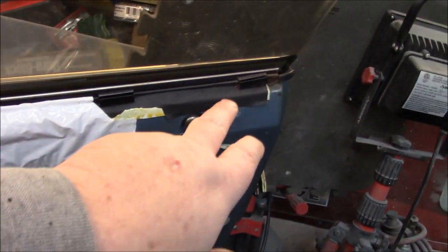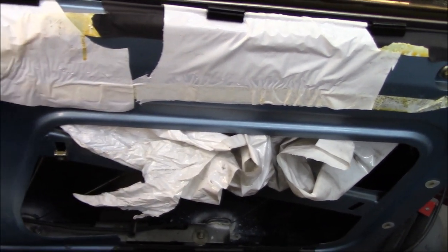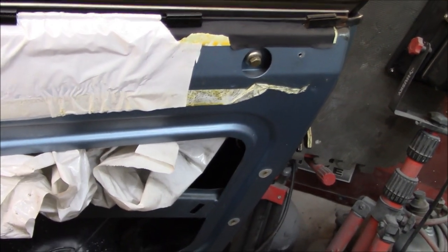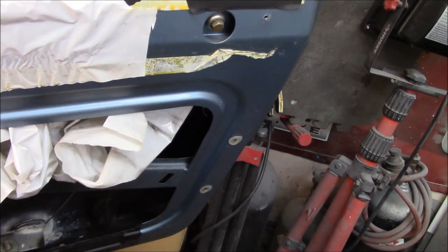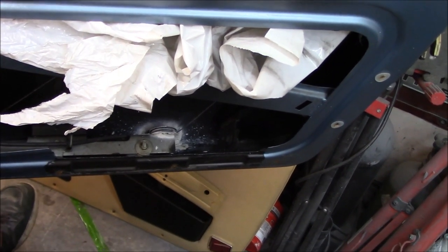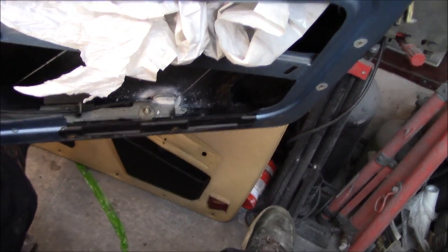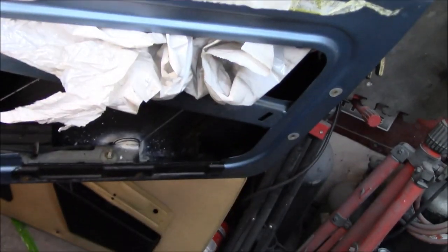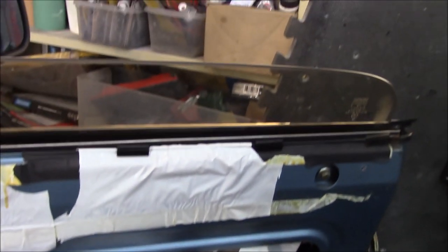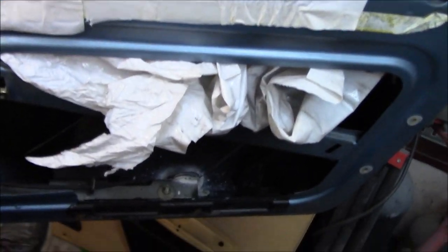Alright, it's another day. I did decide to go ahead and remove that top panel just to see if there's a little bit better access to get to the top pulleys. I think there are two pulleys here and two pulleys here that work this wire mechanism. Unfortunately I'm not going to be able to lubricate those. I'll do a bit more investigation to see if I can get through this opening to do a little bit of lubrication up there. I'm happy though I was able to lubricate the two bottom pulleys and it seems to be operating a little bit better now. The battery is probably a little weak because I've been playing with this. So we're up fully now, let's go down - you can see the wires moving, it actually moves fairly quickly to the down position. A little bit slower going up - it's cold in the garage and battery voltage is probably a little bit low, but working as it should.